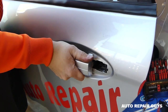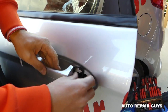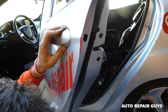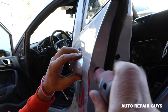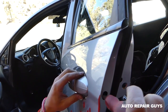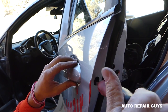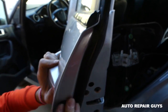Push the door handle in, then pull it so you can release that spring we loaded there. Now install the seal right here. After that, get the cap, install it, and use the Torx 20 screwdriver to find and tighten that screw. Keep getting it tight until the cap is secure.